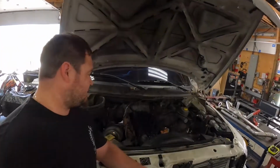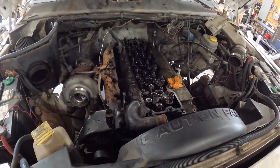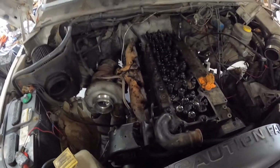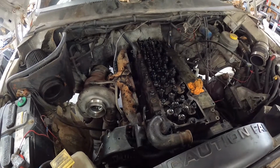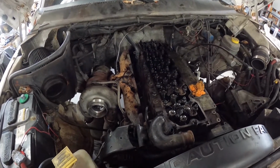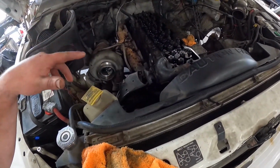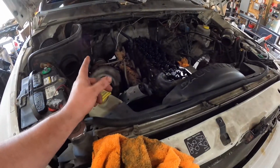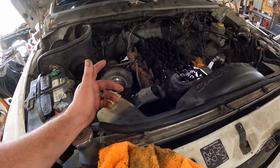All right, we got the head back on it. The head studs in it. We got the rear line in the very back put back on. Definitely a must before you put the rocker arms on there, because it's a real pain in the butt to work around those. So we're gonna put the exhaust manifold back on it, finish out the fuel system, slap a valve cover on it, batten up the wiring, and then we're not gonna fill it with coolant because we still have to do a heater core. So best leave the coolant out, don't have to drain it again.